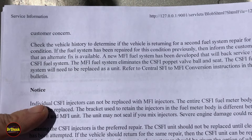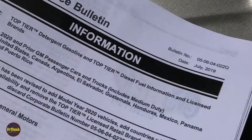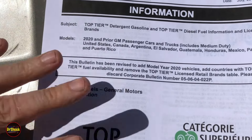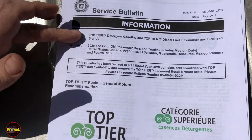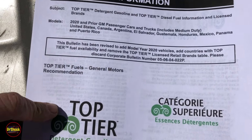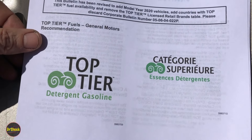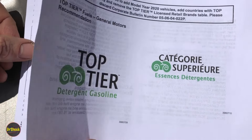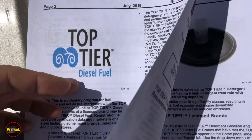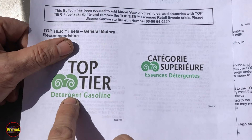Ultimately the problem is fuels — if you have fuels that aren't causing these poppet valves to get deposits, you're not going to have problems with them getting clogged up. The system I'm going to show you today has run for almost 400,000 miles and never had any problems. Part of that comes down to these service bulletins. The first bulletin is about using top tier gas — a current bulletin GM still pushes. Top tier gas is a set of suppliers that have gone above and beyond what the EPA requires, with additional and more powerful detergents added to the gasoline.